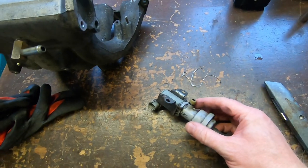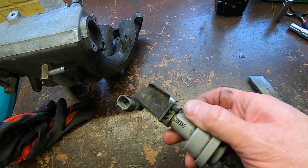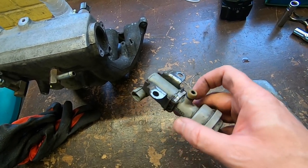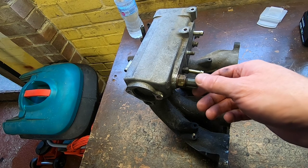Sure enough, underneath the PTFE tape there is an O-ring groove. I can only assume the O-ring was too flat or too thin - I suppose it's better than just putting RTV on it. That's what it's supposed to seal with.